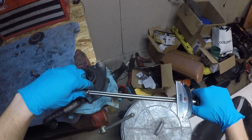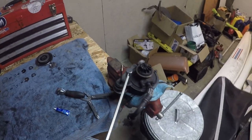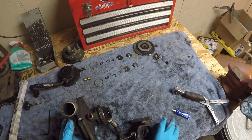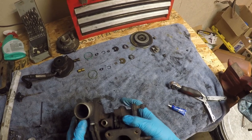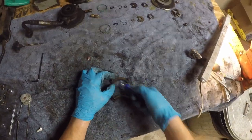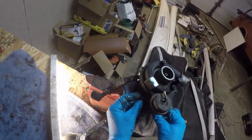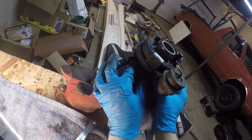I've heard conflicting things about the torque spec for this compressor housing, but I'm doing 15 foot-pounds in an X pattern. Next goes the turbine housing, making sure to get it on there as well as through the wastegate rod. Fortunately you can see the paint marker line locking it up. You can't really get a torque wrench on this, so I'm not worried about it — it's pretty stuck on there with a lot of corrosion on the bare cast iron. Going around in an X pattern and just slowly drawing it down.